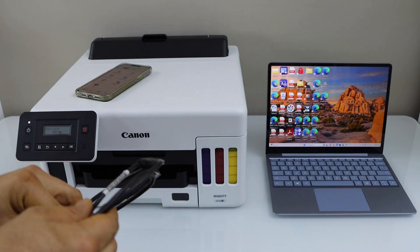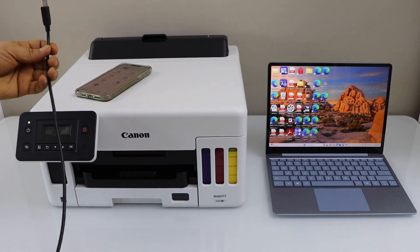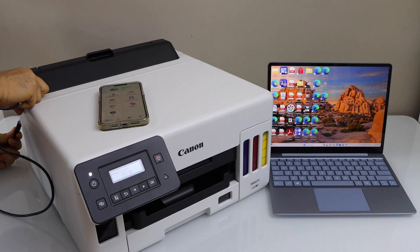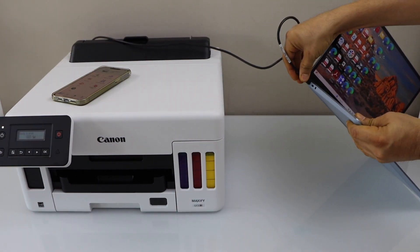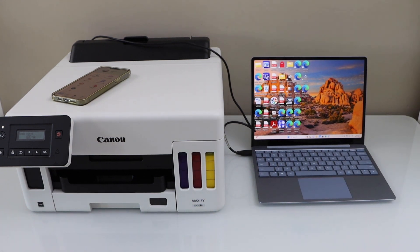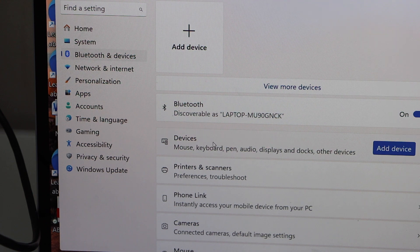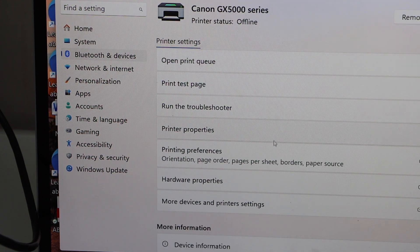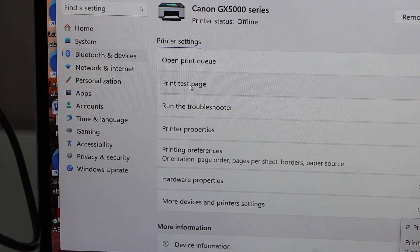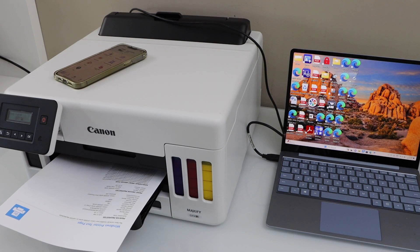Next step is to use this with the Windows laptop. I am going to use it with the USB data cable. If you want to use it wirelessly, you can go to the Canon website and download the drivers for your printer. Plug one end of the USB cable at the back of the printer and the other end goes to your laptop — it should be instantly installed. To double check, go to the Start button, open Settings, click on Bluetooth and Devices, then click on Printers and Scanners. If you scroll here you can see Canon GX 5000 series — it displays all the information. If I click on Print Test Page, it is printing and it is installed. Now you can start using it for wireless printing or using a USB cable. You can print photos or normal documents with this printer. Thanks for watching.